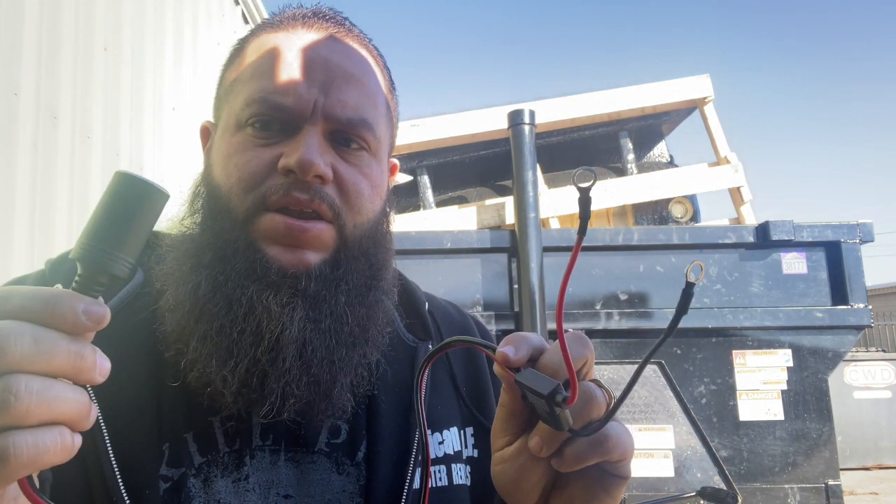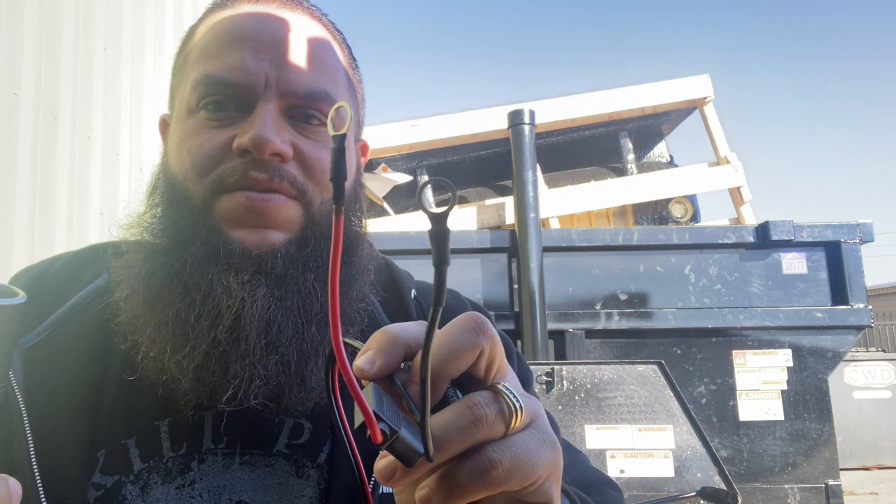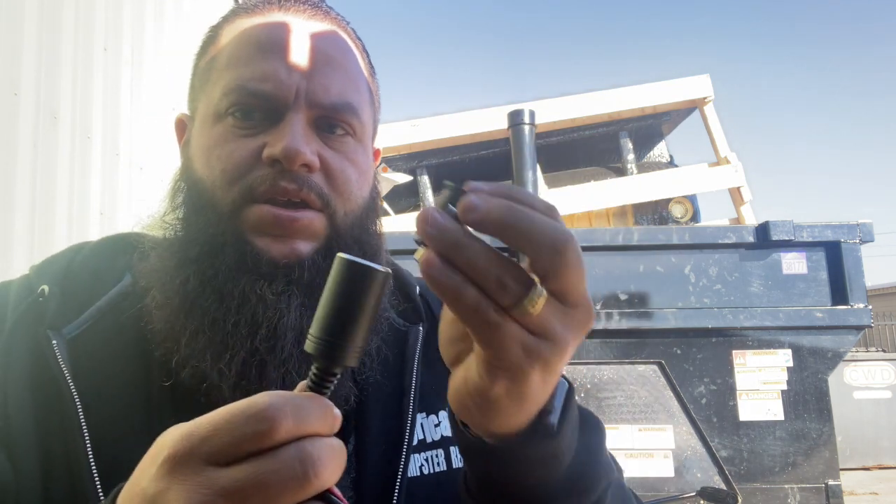What I'm doing is connecting to the battery on the dump trailer and hardwiring a cigarette plug. Super simple — this cost me $8 on Amazon, I'll have the links in the description below. For $8, I'll have constant power to my cigarette plug as long as there's power in the battery. It doesn't take much juice. It's a simple positive and negative — two wires connected to the battery — and then you plug in a little USB outlet into the cigarette plug, which then powers your GPS tracking device. For $16 total, you constantly have power to your tracking device without draining the battery.